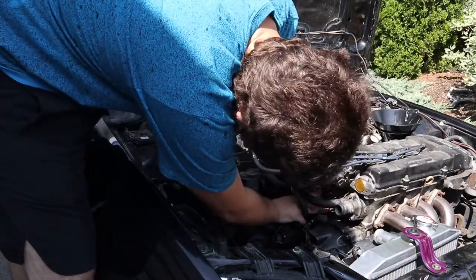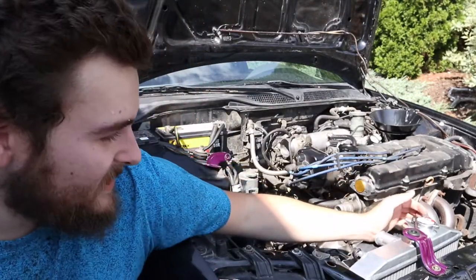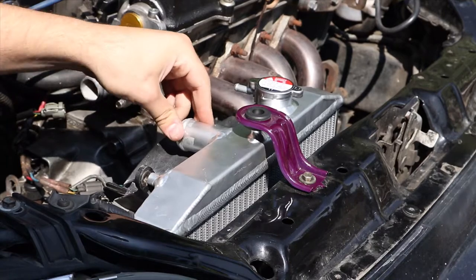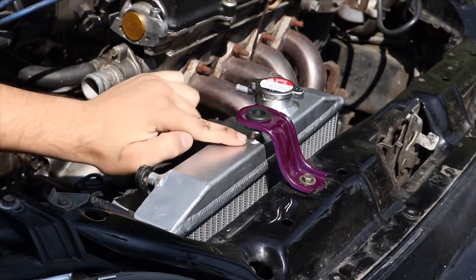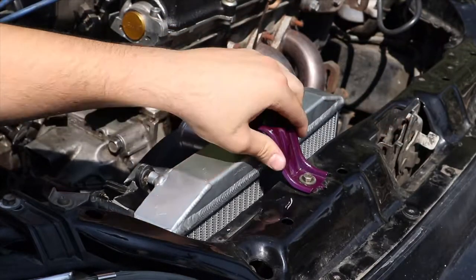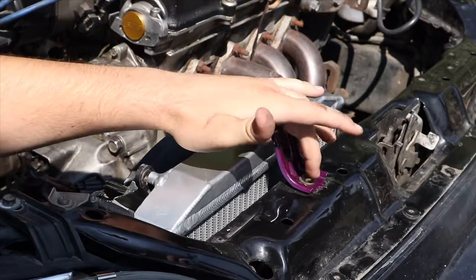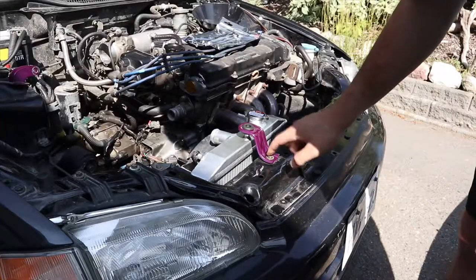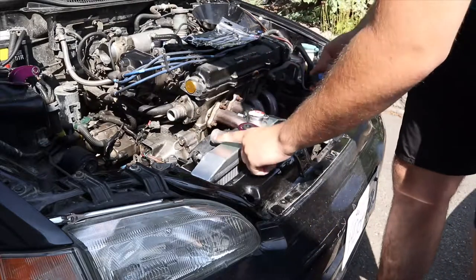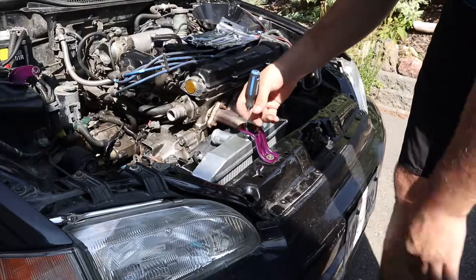Just get it hand tight — you don't need to reef down on these sensors. So a little issue we're running into: this radiator is a little bit shorter, so we have some play in here. I could wrap duct tape around the little prong that sits in here, or try and bend it down, but I can't get it any tighter by hand and it's still very loose. I'm gonna tighten it down and see how much play we get. Even fully tightened down, there's just the slightest bit of play, but if you stick something in there it's solid. We'll figure it out — it's not a huge deal right now.